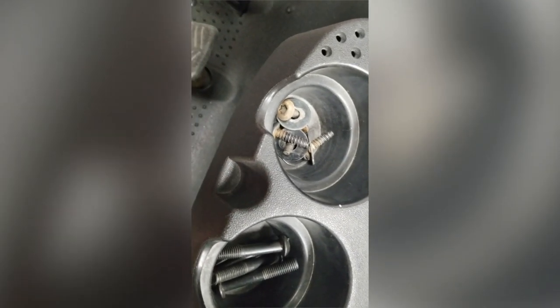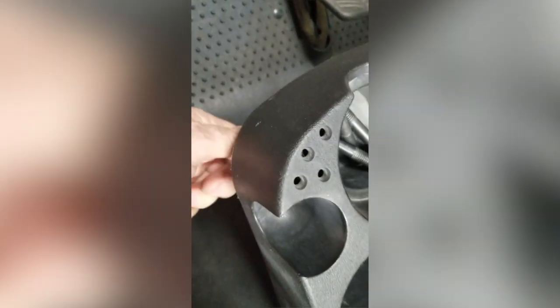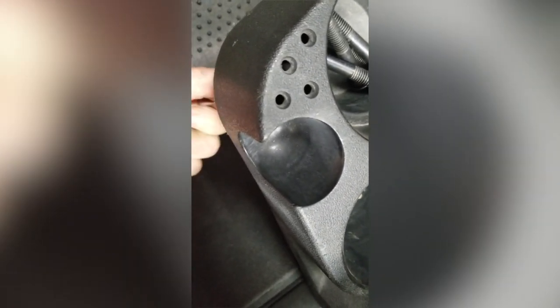You see these three indents — one, two, and this one right underneath there — there's a 10-millimeter nut just hand tight. There it is, that's what it looks like. You take that one off, you reach under and take this one off. Trying to hold the camera and be a left-hand mechanic sucks. There's that one, and there's going to be one more behind here. There's the three nuts I took off, and this thing just pulls up after you get those off.